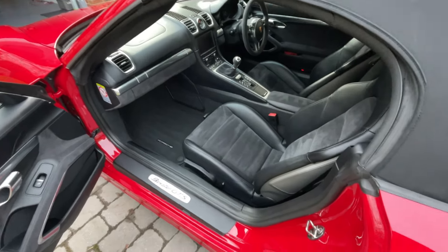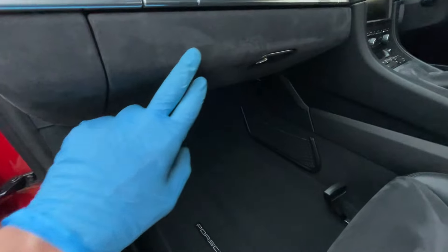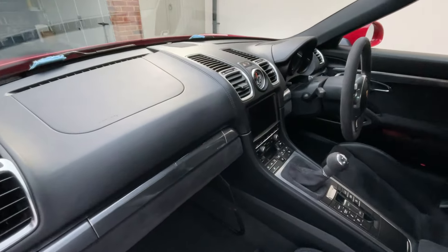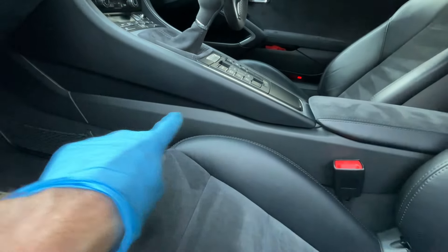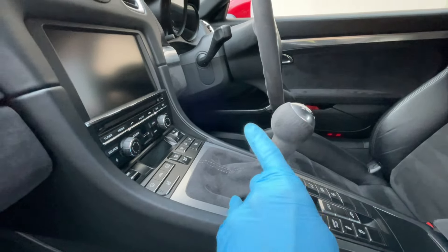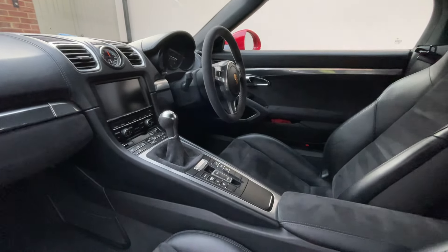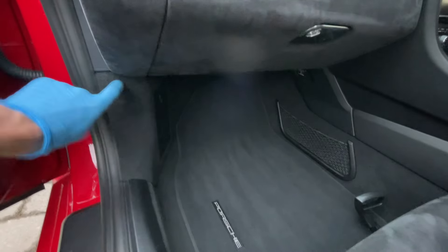The Alcantara has now been brushed and that's come out pretty well. You can see on the seat that pattern you expect — a nice lifted pile. I've also gone around and taken the sheen off the leather, wiped the overspray off where the conditioning cream got onto the plastic. I'm really chuffed with that — the whole interior is looking bang on. Here's a little hint by the way: you should be able to see pile on your gear stick if you've got the manual, same with the steering wheel — it really shouldn't be hard, it should be soft, which is where it gets its grip from. I've also reinstated a new trim piece, so that's gone in.